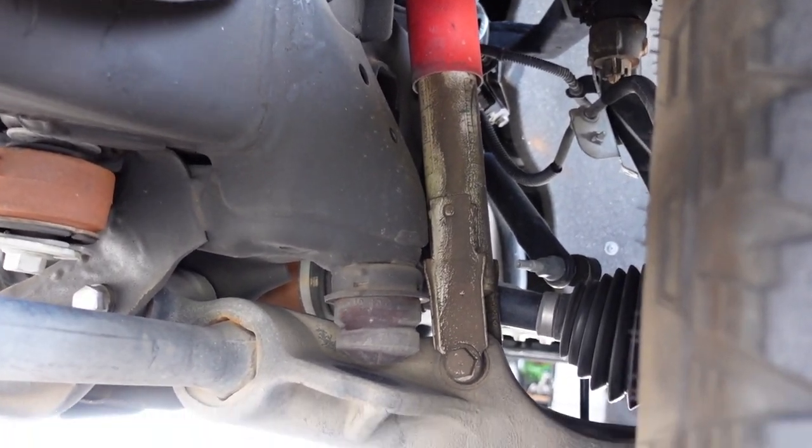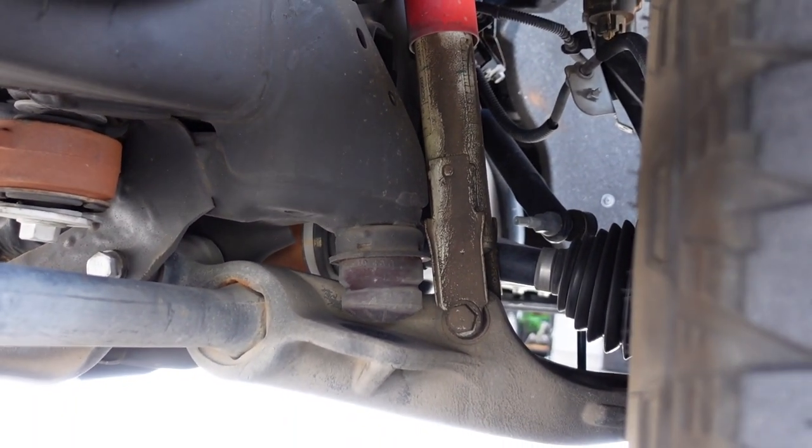One more thing that the 2500 and 3500 series trucks have in common is that they ride kind of rough if you're driving around every day without any extra load. I've got the tire pressure back down to like 56 PSI — that's right on the threshold of where the TPMS light will come on — and the thing does ride pretty rough. I've been doing some research and there are two products I think I'm going to try: Cognito actually has a different torsion bar up front — they call it a smooth ride torsion bar — and number two, Sulastic Shackles for the back. Those are supposedly something you can throw on there that'll make a 2500 HD truck ride more like a 1500. But for now we're just going to be working with shocks.